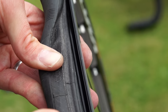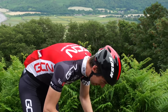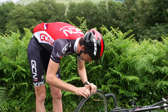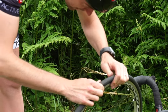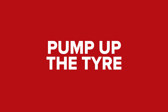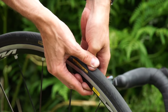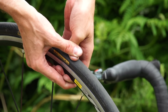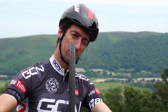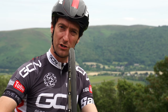I've just got a bit here where you can see the inner tube underneath the tyre, so before we start to pump it up we want to make sure that the inner tube is firmly inside the tyre. There's no specific technique for this, it's just simply a case of trying to roll it around until you can't see the inner tube anymore on both sides. Once you're happy with that, we can begin pumping. That's pretty hard now — I reckon that must be somewhere up towards 100 psi. There's one last check: give the wheel a quick spin and make sure it's fairly smooth all the way around. If you get any big wobbles up and down the tyre, it generally means that you've got your tube snagged underneath.